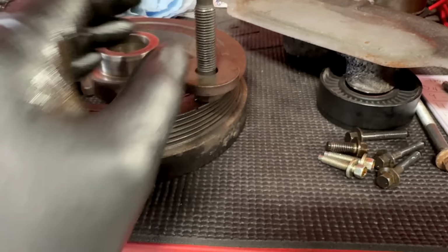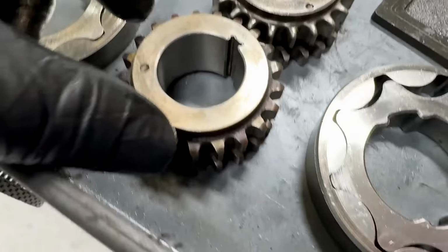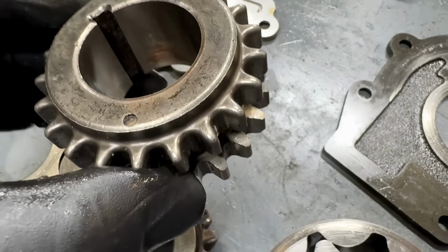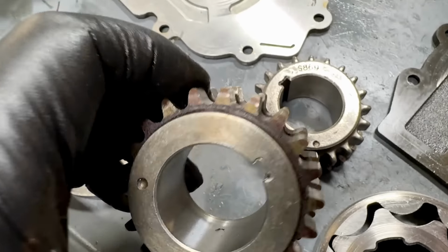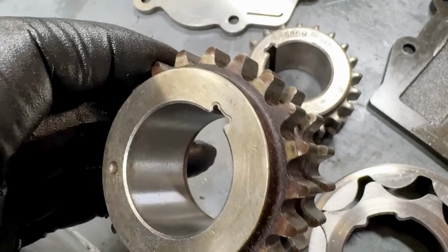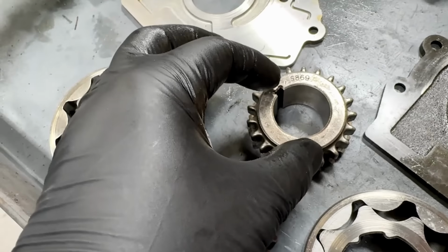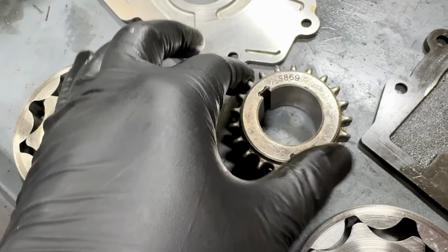When that happened, this dampener was not pressing against the actual sprocket down here, which again, look at this aftermarket one right here. Look at the quality of that compared to an old Ford one. Wow. Much better quality. That's the first thing I'm gonna say. But that dampener comes down, gets bolted and torqued down and presses hard against the nose of the crankshaft and this little timing gear down here. Well, they didn't tighten it, so guess what?